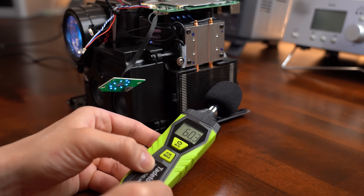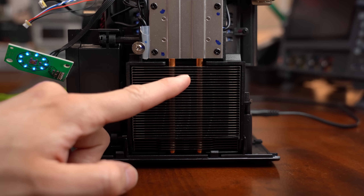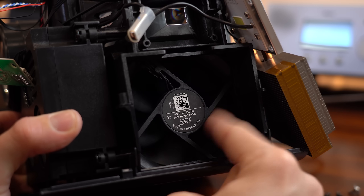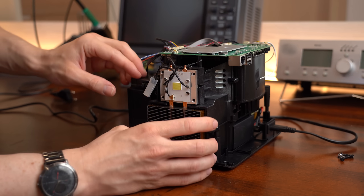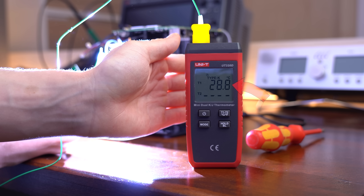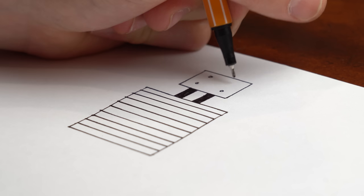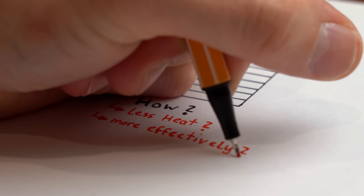Now at this point it was quite easy to figure out where the loud fan noise was coming from, but it was honestly not easy to see behind this heatsink. So I removed some more screws, pulled the heatsink out and was greeted by our annoyingly loud fan. I quickly realized why it was that loud because the heatsink system it cools off is for the high power LED of the projector, which is not only insanely bright but also heats up the air in front of it noticeably. So to make the fan quieter we have to understand how this heatsink system works and what can be changed to produce less heat or get rid of the heat more effectively.